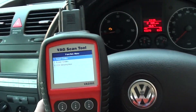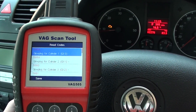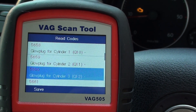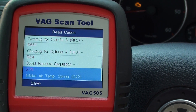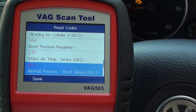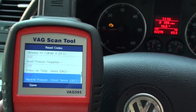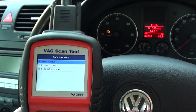I'm just going to show you the trouble codes first of all. There are a few codes on here relating to a previous fault regarding the glow plugs in all cylinders. But the faults we were looking at — codes 564, 275, and 568 — were relating to the MAP sensor and the mass air flow meter.